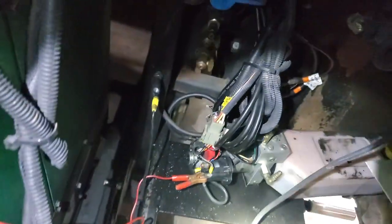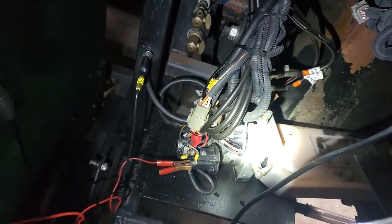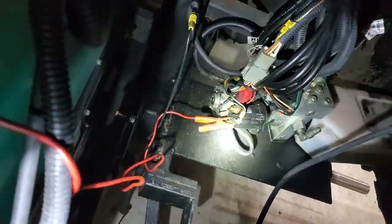So up front, driver's position — not right or left because it depends how you're sitting in it — that is the hydraulic pump assembly, a Lippert system that makes the slide go in and out. It is a one-direction electric motor, but the hydraulic fluid flows in two different directions.